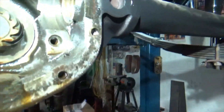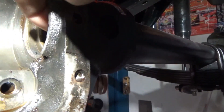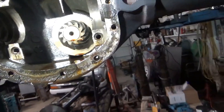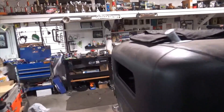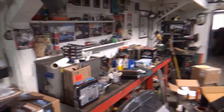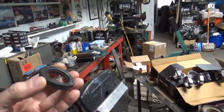International specified that the inner seal be a different outside diameter for some reason. There's a seal that goes in here on this lip on both sides, and for some reason it's 80 thousandths smaller for those two particular years. This is what the seal looked like originally — of course you pretty much wreck it getting it out of there.